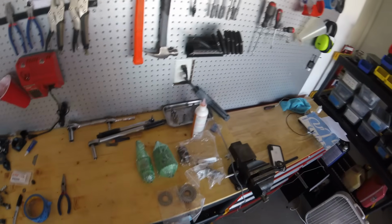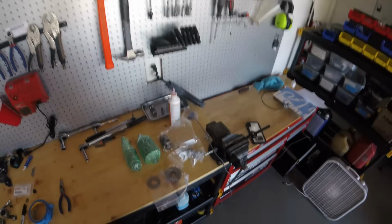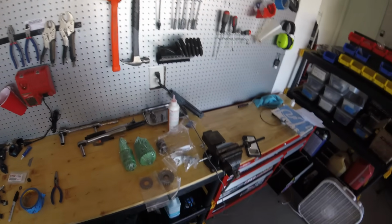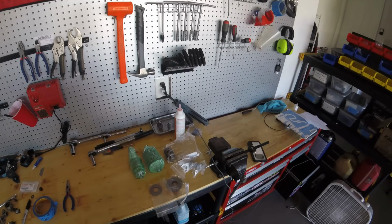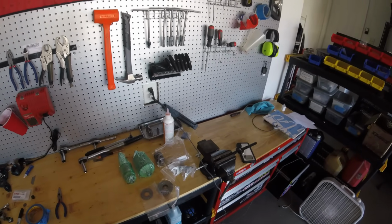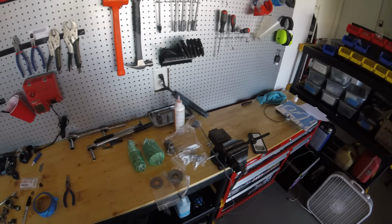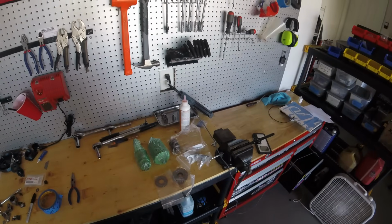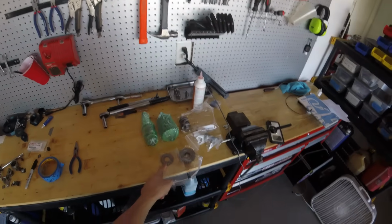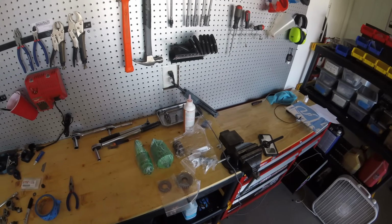The reason these are necessary is because, as mentioned in previous videos, the primary reduction between the crank and the clutch is increased on this bike to gear it essentially taller. This will take torque out of the gearbox. It'll make the gearbox spin faster but have less torque on it, which is a good thing because this bike's making a lot more torque than the stock one, and the bearings are rated for a higher speed anyway, so this is a pretty effective way of ensuring transmission longevity on an application they weren't originally designed for. And because this gear was bigger, I also had to make the water pump gear bigger, which also isn't a bad thing because that's going to overdrive the water pump a little bit and increase the flow of coolant.